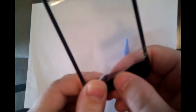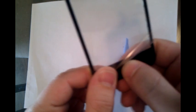So you want to take the top portion right here, the cable, make sure it tucks behind, and then you don't want to do the top first. You want to make sure that the bottom portion is what goes on first. You want to align the home button up. Always line it up there, pull this back a little bit, make sure that the home button is still fully functional. That feels good there. Nice and easy to press it.